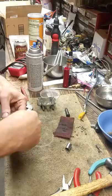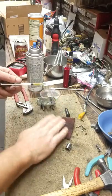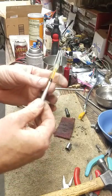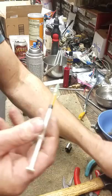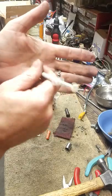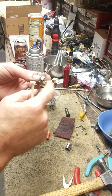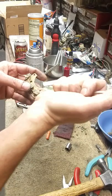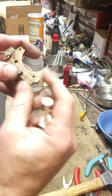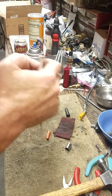It's all clean. I showed it in my other video — 20-weight oil, simple little syringe. These are ones you can buy just about anywhere. You can take this piece off, it twists off, you can buy replacements — this is flat, won't hurt you, no point. 20-weight motor oil, just a little bit in here. After blowing it all off with an air gun and getting all the crap out, a little bit in here — just enough that you can barely see it. Work it in there, doesn't take much. It survived all these years without it, but now it's going to last even longer.